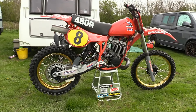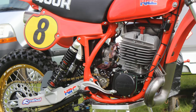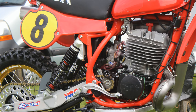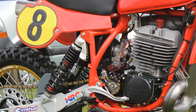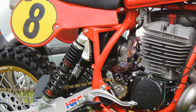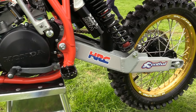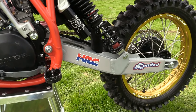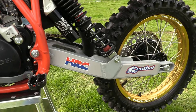The entire process of turning these evolution racers into old twin shock bikes usually involves a bit of surgery to the back end of the evolution bike's frame, then welding on mounting points both onto the frame and onto the swing arm to enable it to take a pair of old school twin shocks, as opposed to the conventional single shock used on EVO bikes. Other modifications are also carried out on the bike's swing arm, where a normal straight EVO swing arm would be cut in half, modified to put an angle or dog leg on it, and then welded back together.